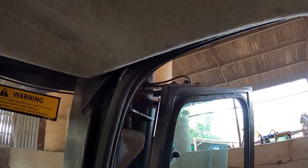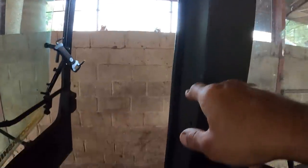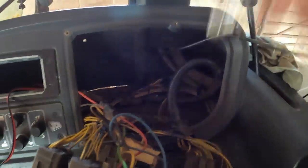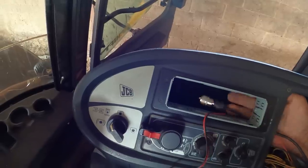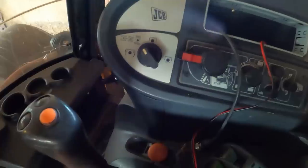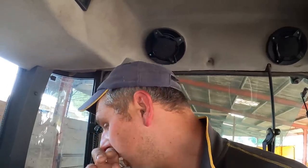The aerial mount is on the mirror arm there. The cable comes along here, tucked in along the side of the roof, comes down the C pillar and then down — should be in the back behind this panel. We've just took the screws out and yes, there is the aerial cable. Pull that through, like so, through into there. That is everything I need behind the radio now, so we can get the radio in.